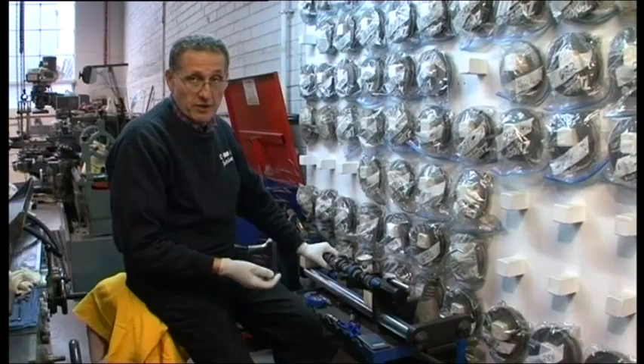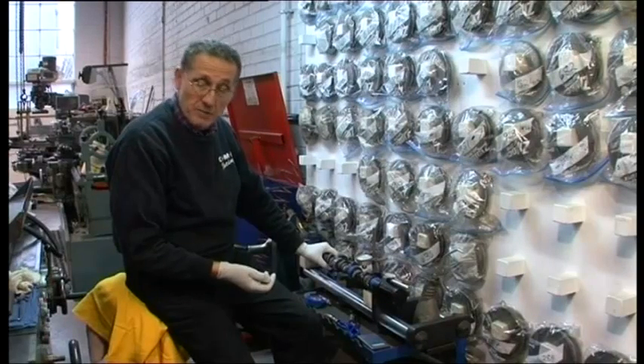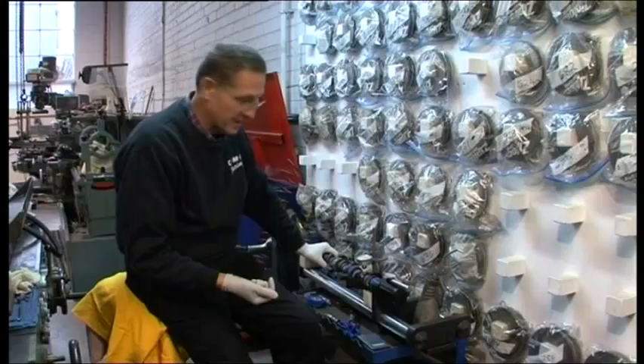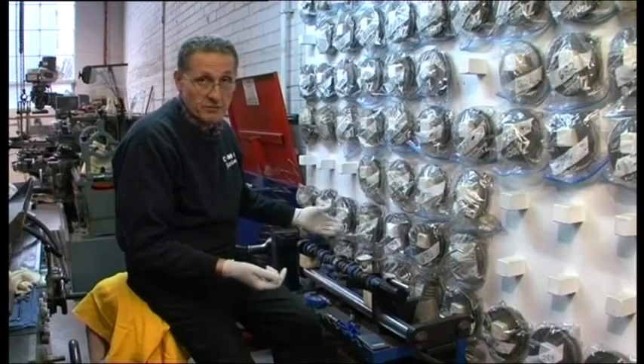It's important to check it and they're actually quite easy to straighten. Put it between a couple of centres — an old lathe with a dial indicator. You can even stick it in a block and check it from above. Whoever you bought the cam off, ask them if the amount of runout you have is a problem. I like to see them under two thousandths — minimum is better.